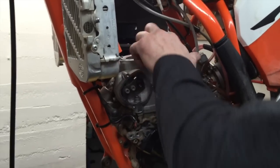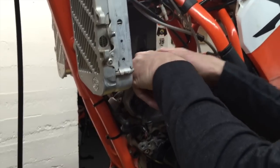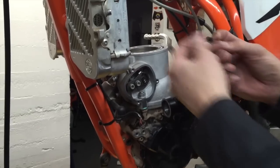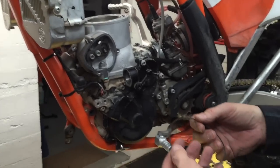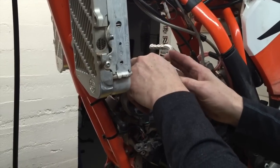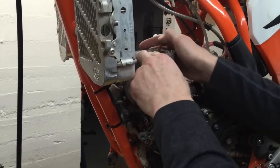So now it's time to put in the head O-rings, and sometimes they don't fit perfectly. This one actually looks like it's going to fit perfectly. Because sometimes they're maybe just a hair too small and you might have to stretch them a little. And then sometimes maybe they're just a little bit twisted or something, and you can take grease and put in this groove. You can put grease all the way around both grooves and then set the O-ring in there, and that will hold the O-ring in place while you install the head. And it can be just any kind of grease, wheel bearing grease, whatever, it doesn't matter.